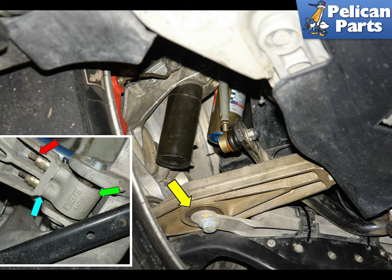This photo shows the underside of a Porsche Cup car with fully adjustable suspension, specifically the GT3 adjustable control arms. The caster can be adjusted by using an eccentric bolt that mates with the control arm (yellow arrow). The insert photo shows the opposite side of the control arm, which is a two-piece design that can be shortened or lengthened using shims based on the amount of additional camber required (blue arrow). The green arrow shows the smaller inside part of the control arm, and the red arrow shows the studs that mount it to the outer part. Add or subtract shims between the two in order to increase or decrease the camber.